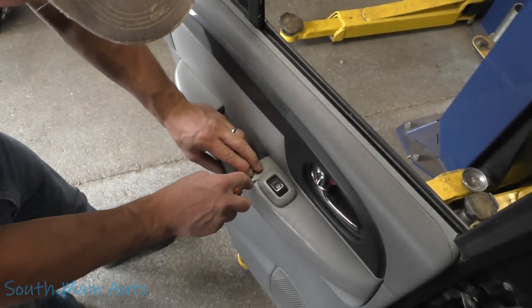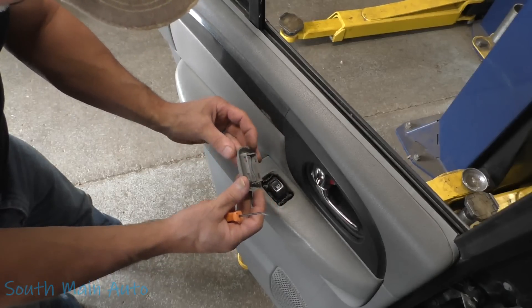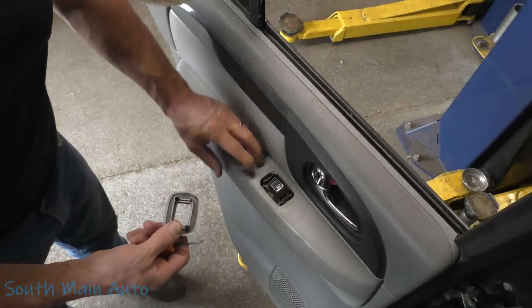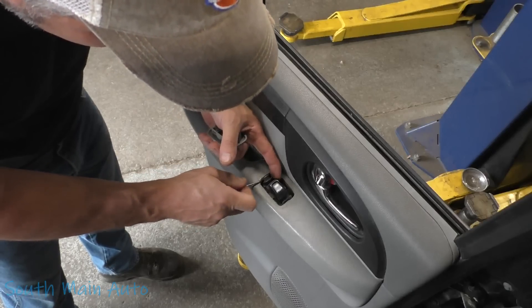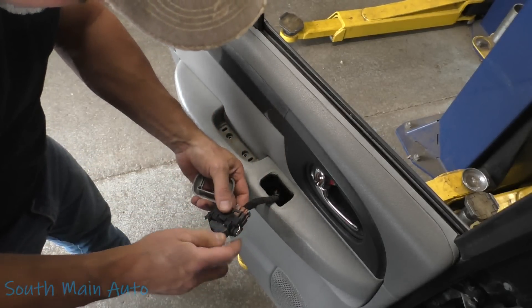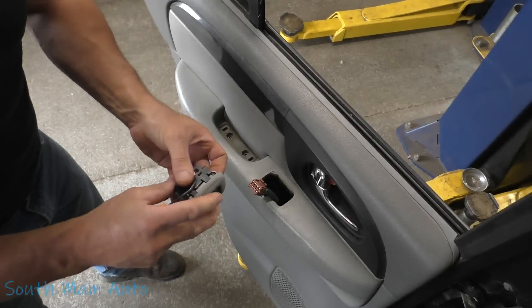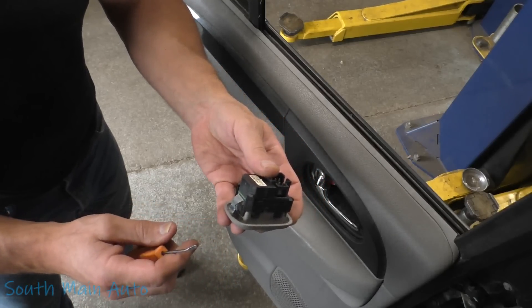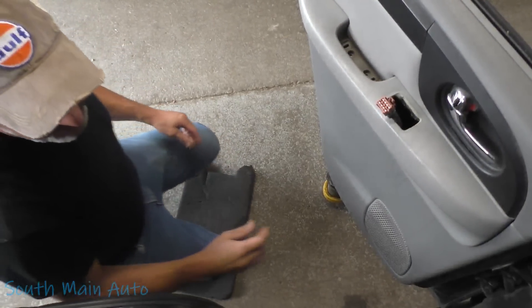Let's give it a little try — I didn't really care for that. Interesting — this is just a trim piece with four little latches that go over the switch. The switch has a metal retaining tab on the back and one on the front. Honestly, it's probably not necessary to pull this; you could just unhook it with the panel off. I'll put this back — it didn't break, which is good. Those are the metal tabs that hold it in, just FYI.